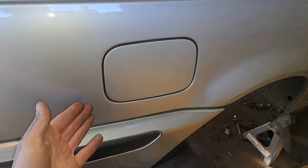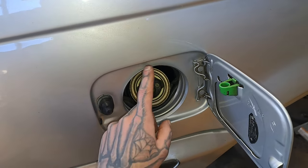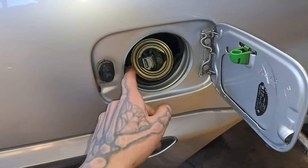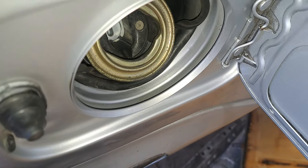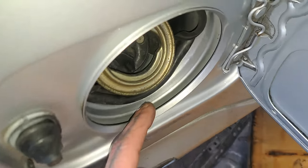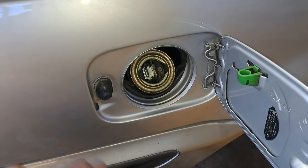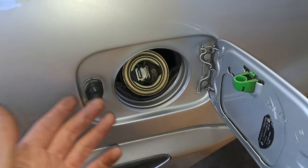Working outside at the fuel filler door location, we're going to open up the filler door and remove the filler cap. We're also going to take the rubber boot, which snaps onto this outer dish and seals this, and recess it — push it in to expose this valley or void right here, which runs down directly into the body of the car. Whenever your boot begins ripping or cracking, water is free to drip down inside and enter directly into the body of the car — not only into the trunk area but also to this seam here. So we're going to take our cavity wax and spray it in there as deep as we can to really fill this void and channel. We're then going to reinstall our boot and check for any cracks around the ring of it. If it is cracked, I'm simply going to use black RTV or some kind of silicone. You can also buy this boot new from BMW, but in my case it's better just to RTV because it's barely cracked.